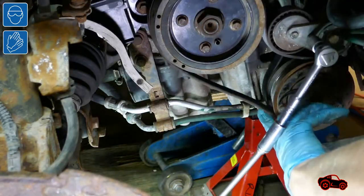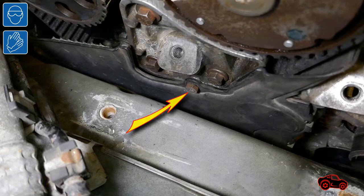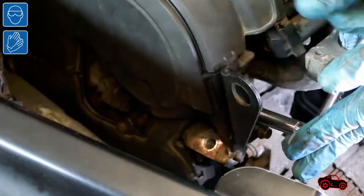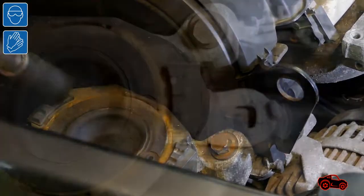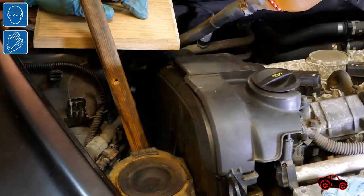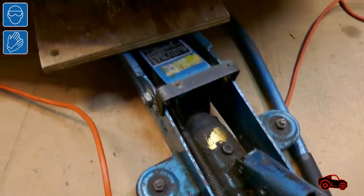I also refitted the AC compressor drive belt. Next, I installed the timing belt lower side cover, tightened the cover bolt to specs, and fastened the cover clips. I installed the upper side cover and the front engine lift bracket. Not long after, I lifted the engine to refit the engine mount component and tightened the two bolts to specs. Because the engine moved a bit during the work, I had to pry it back in place to install the second part of the engine mount assembly. The two retaining bolts were tightened to specs. After, I removed the floor jack from under the oil pan.